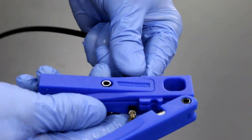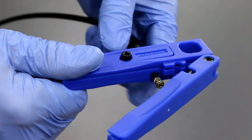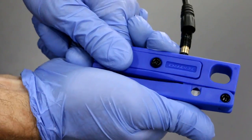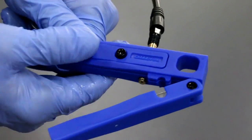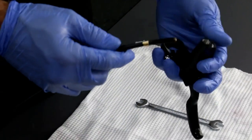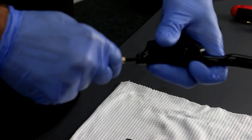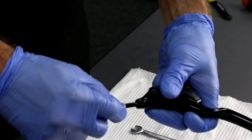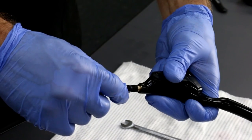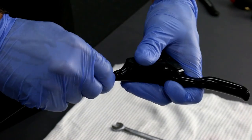Slide the hose through, hold the hose, and press the insert all the way in. Sliding it back out. Next, insert the hose into the lever body, making sure it's all the way in. Then slide the compression sleeve and thread the compression bolt.